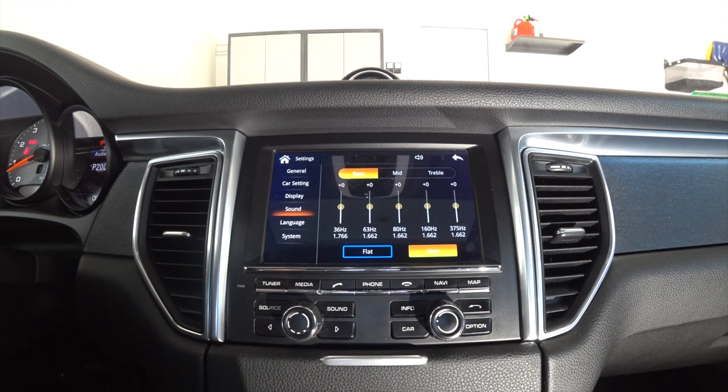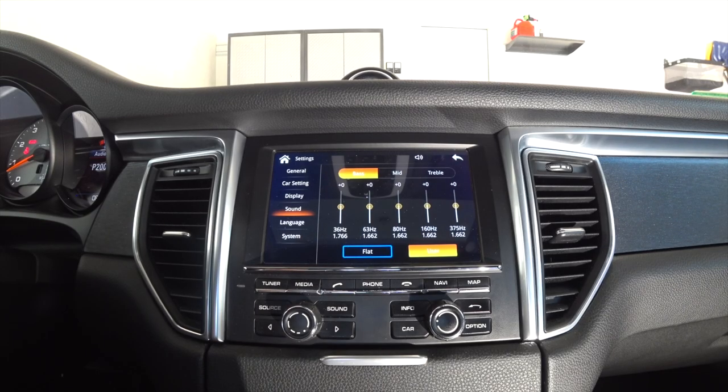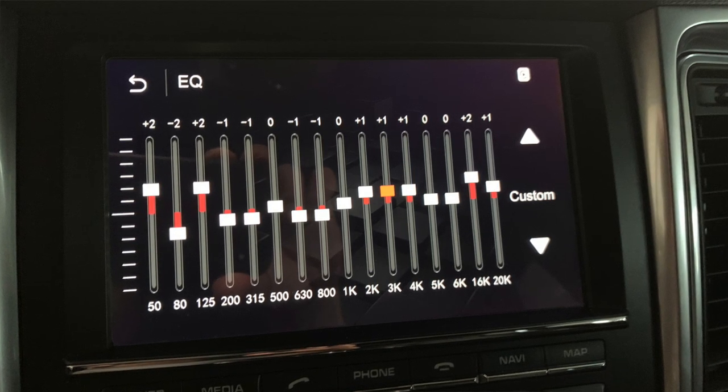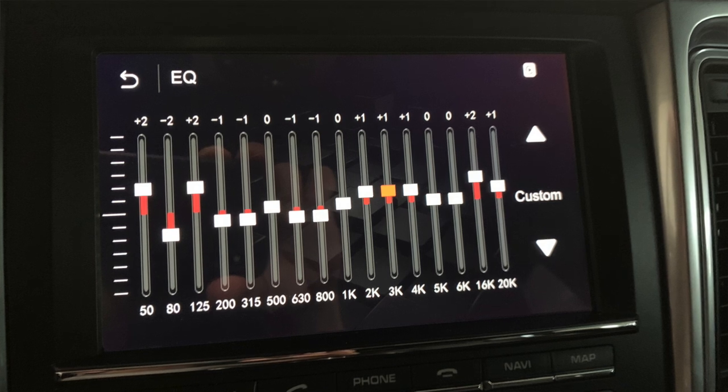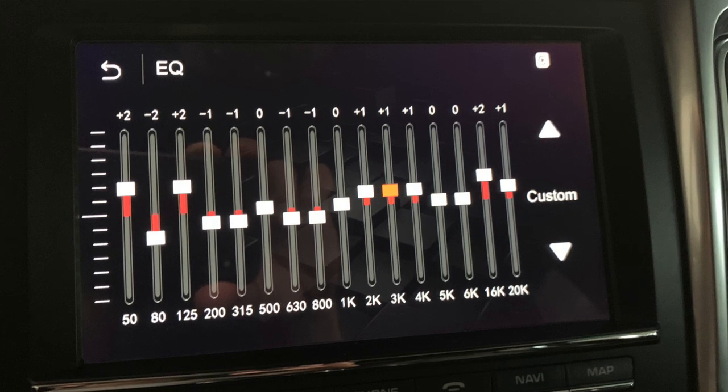So as you can see, the Joye system running ID Core had a fixed 8-band equalizer for tuning. This certainly gives you more options than native PCM to try to fix and tune your audio a little bit better. But new systems have evolved and provide us with even more flexibility. The Isudar, for example, has a fixed 16-band equalizer, which provides a lot of flexibility to tune the system to your liking or close to a Harman curve, which is an accepted standard response curve for enclosed mobile systems like automotive audio.